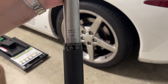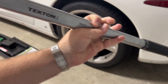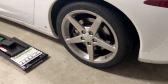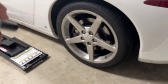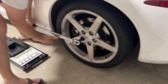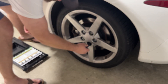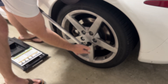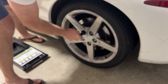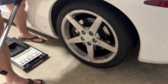I'm not sure if it's going to be able to focus on it, but I am at 90 foot-pounds on my Tekton torque wrench. Hopefully it should click on each of these, being that I should be at 100 foot-pounds, not 90. But here we go. Starting good. So this bottom one definitely was still able to be tightened some — same on this one and a little bit there as well.